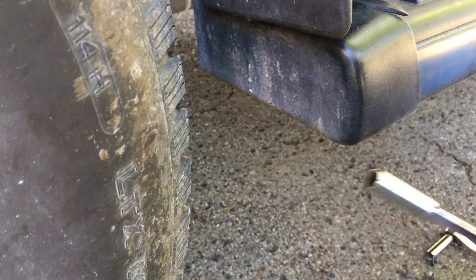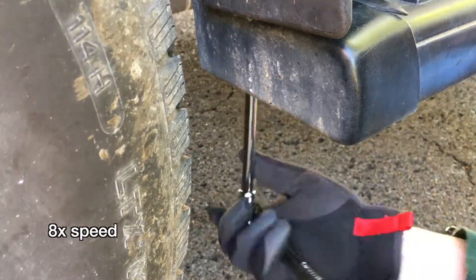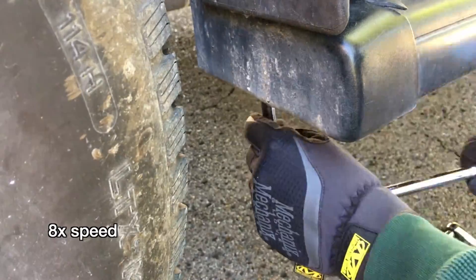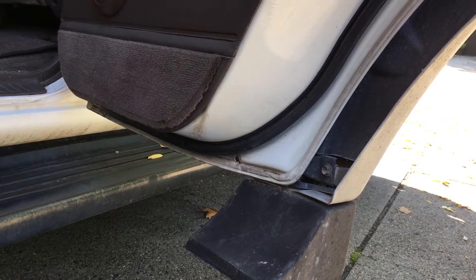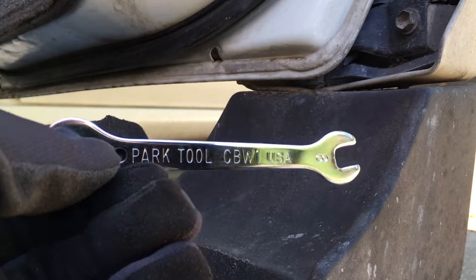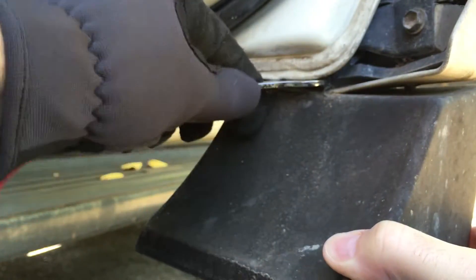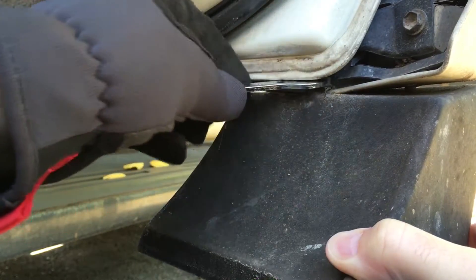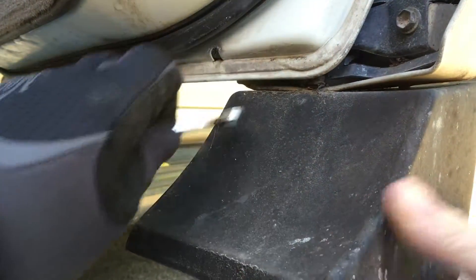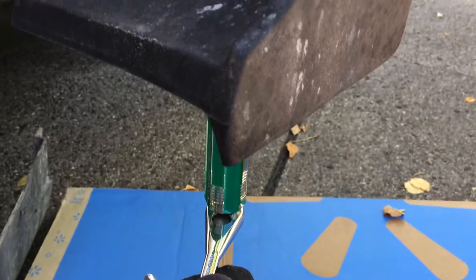It's turning now but I think I just egged out the top — it's probably like a carriage bolt. It doesn't seem to have loosened up at all. I'm behind this rear passenger door and I'm going to try this again. I think I can put a wrench in there and get that nut off. I'm using this Park Tools CBW1 — this is a bicycle brake adjusting wrench. If I bend this down it looks like I can get in here. Even better — I found out this is a bolt that goes in through the bottom, so I can turn it from the bottom and just put the wrench in on the top.